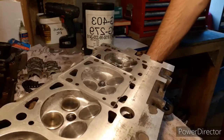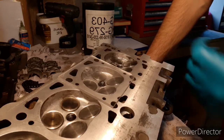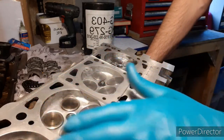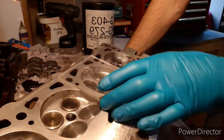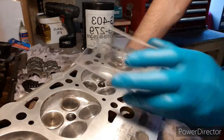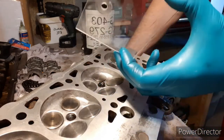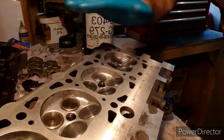So we've measured the head thickness and confirmed it's at 118.1, giving us the right compression ratio. Now we want to measure the bowl of the cylinder head. This is pretty simple to do — it's a piece of perspex with a hole drilled in it and a couple of small indents, because the 16 valve valves sit just flush with the cylinder head. That goes on there like that — you can pick this up from anywhere, off eBay for about two quid. Put a spark plug in the spark plug hole so that hole is blocked up.